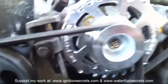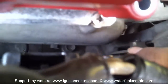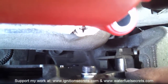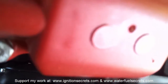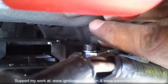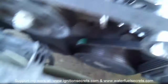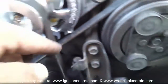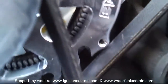A few minor details about what I don't like about this DC Power Engineering alternator. For one, this right-side mount — this bolt right here — that little piece of metal is supposed to wrap behind it and on top, so that should have been machined down a little bit more. Nobody there has probably actually installed one. The other issue is that this AC compressor belt rubs on it and is touching — that needs to be ground down quite a bit.